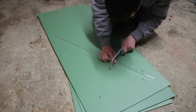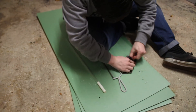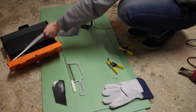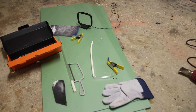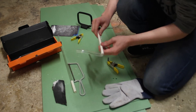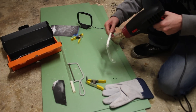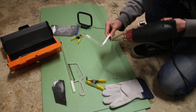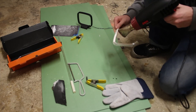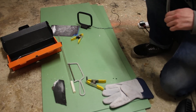So a quick guide on how to hard pipe watercool. First things first: make sure you order double the amount of pipe you think you need. If you think you're going to need two metres or two tubes, it's seriously worth buying four. I thought I was going to use about two so I got three — breaking my own rule — but it actually worked out quite well. I do still have a decent amount of pipe left, about half of the third pipe. Just cut a bit close with a couple of mess-ups.